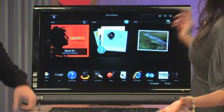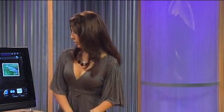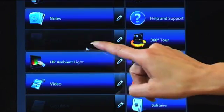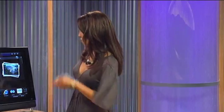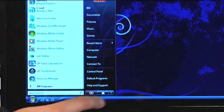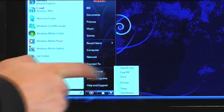If you see Photos and touch it but it's still not working, go back to Personalize and toggle it — turn it off and then right back on. If those two things don't work and you still can't get into Photos, close out HP TouchSmart and then relaunch it all over again. If that still doesn't work, restart the computer as Bob described. Another thing you can also do is make sure that you have been accepting all your HP updates.